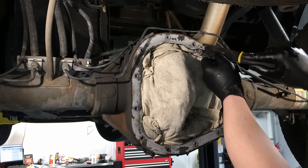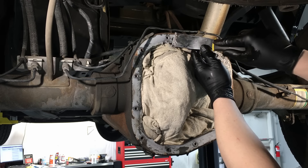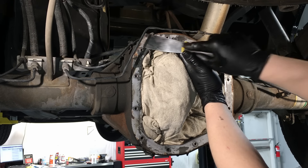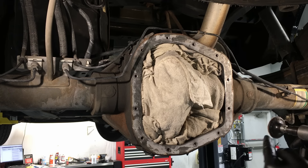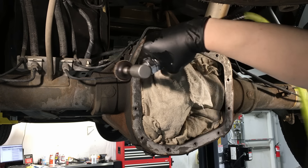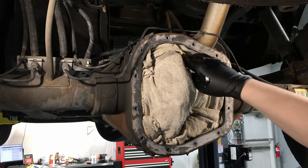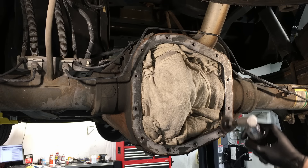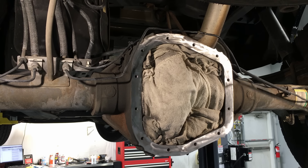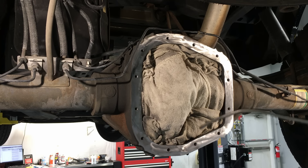No matter what cleaning method you use, you're going to put a lot of debris into that case if you don't cover it. Now, this disc spins so it flings debris away from the center, so you want to work in the same direction — flicking away from the center of the diff — both across the top and down below. You'll also want to watch those rags while you're working. Once the sealing surface is all cleaned up, clean out each bolt hole with compressed air to get any sealant out so they're nice and clean for reassembly.